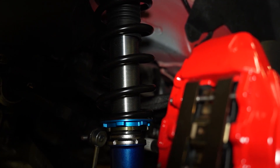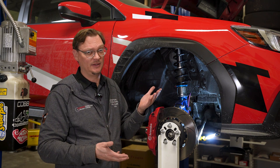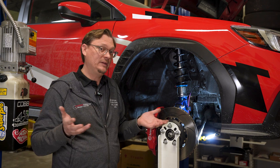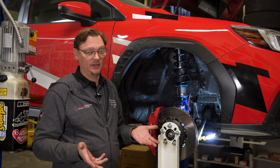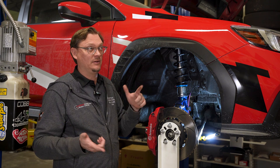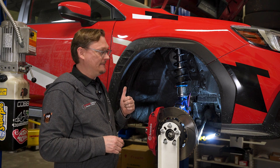Be aware there are going to be limitations you might run into. Our starting point was already one inch higher than stock, and now we're about an inch and a half higher than stock. If we then wanted to be an inch lower than stock, there's almost no way to do that while keeping any kind of travel balance — moving the spring perch down would drop the height but leave almost no compression travel. There are also physical limits to how low you can spin a strut body into the bottom bracket, and we'd probably hit that limit well before reaching the 50 millimeters of adjustment needed to get back to stock ride height.